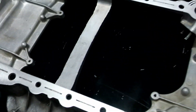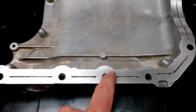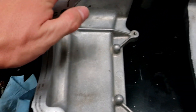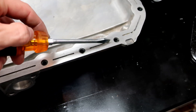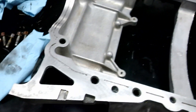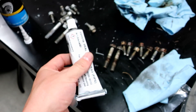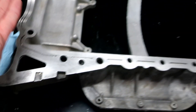The only things we're reusing are the pickup and the splash guard. We need to use some FIPG — run it around like this. Take a screwdriver and run it down in these edges to get all the old residue out, because that actually helps hold the sealant and keep it lasting. I also recommend don't cheap out on this: spend the $15 and buy Toyota FIPG. This stuff really works and will make your car look like new.